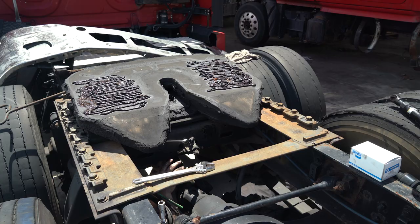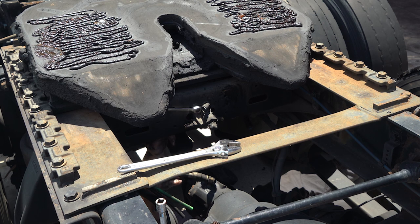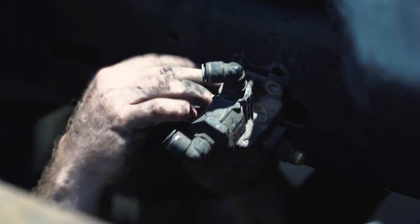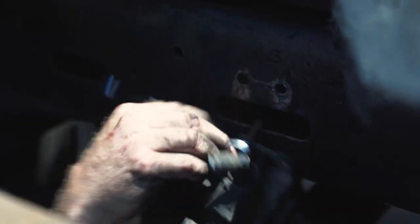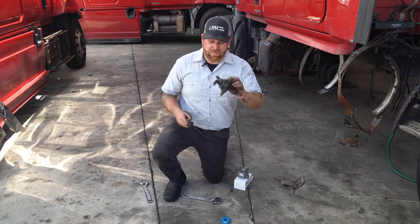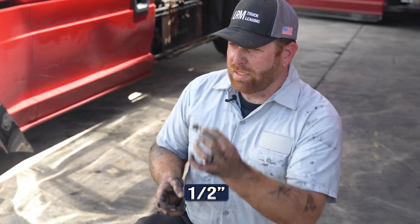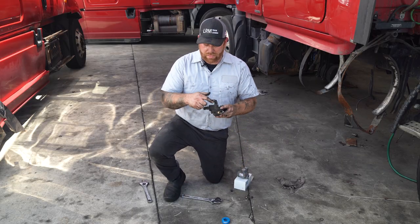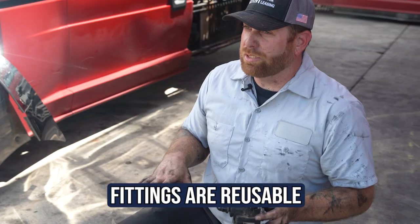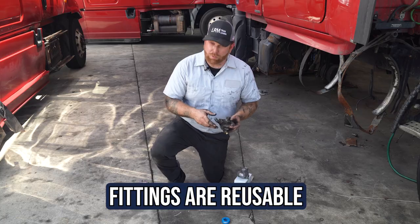Now that you have all the airlines removed, here comes the dirty part — we're going to get underneath the truck. There's going to be a slotted hole. You're going to have to use your half-inch wrench, snake it in there, hold it from the inside, and use another wrench or socket to remove the bolt from this side. So we have two bolts and a nut — the nut's on the inside, there are two slotted holes, and you've got to put your wrench through to hold the backside. Now the valve is out. The fittings should be reusable; in this case, I'm going to reuse them since there's nothing wrong with them.